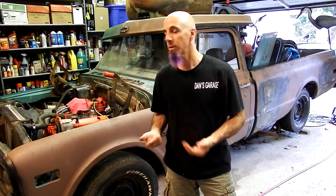So that's it. The track bar bushings was actually one of the easier jobs on these trucks. You don't need a lift. You could do it with just a jack and a couple of jack stands as long as you can get under your truck. If it's lowered or you have a crazy different suspension from stock, then you may need an adjustable track bar. If you're doing that, they usually come with the bushings, and you may need to adjust it with center line and all sorts of stuff that we're not dealing with on this one here. So we're going to call that one a wrap, and see you in the next one.